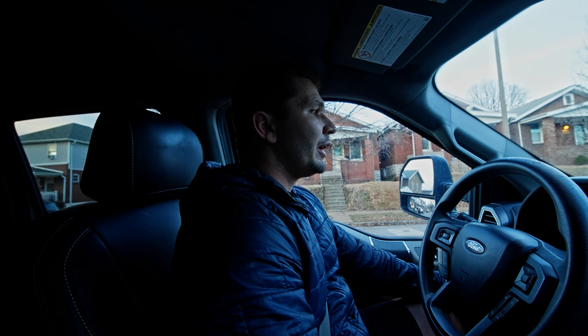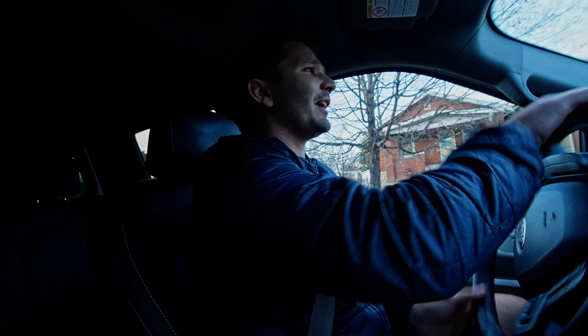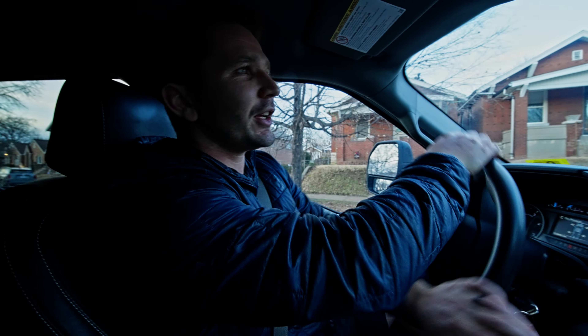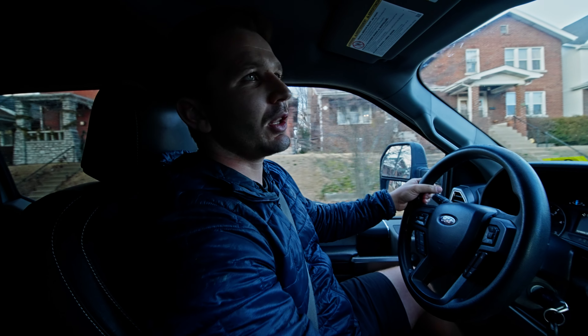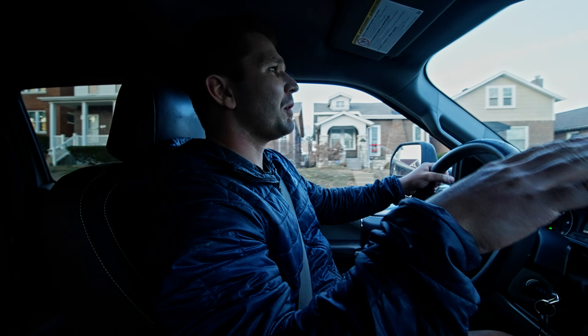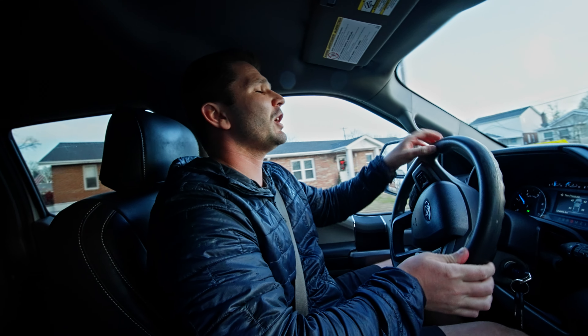We're going to drive around back and I'll take out my pump to make sure all tires have exactly 45 psi, then do the chalk test on my tires, which are a lot larger than David's — I have 35x1250s. We're going to see if running 45 psi is actually correct or if I need to lower my pressure. I've done chalk tests before and I know that 45 psi isn't quite low enough to get totally even wear — it's towards the top end of being almost over-inflated. But I didn't want to lose too much fuel economy, and 40 psi felt too mushy, so I kept it at 45.